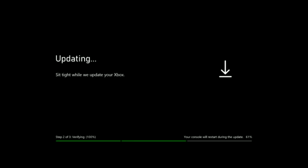I'm just going to grab my cable from the microscope quickly. Ha! My cable's broken. Well, there you go. Plug the original hard drive in. One moment. Okay, we have an E100 error. Yeah, E100, that's a hard drive error.